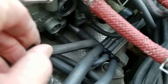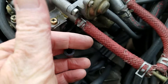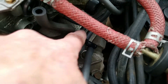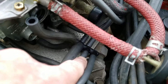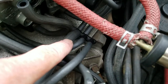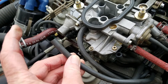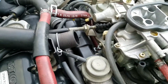Right off of that plate is this one that's going to be loose — that comes up and connects just right there in the bottom of the little plastic thing on the bottom of the air filter. The first one on this side is this fat one that comes up and connects to the stop valve here. The second one is that long green one that went to the other side. The furthest one out connects to a vacuum connection under the air filter, and right next to that is where this guy connects also, and the thing underneath the air cleaner assembly.